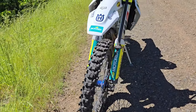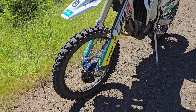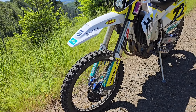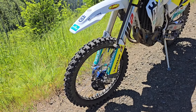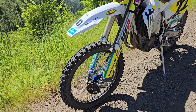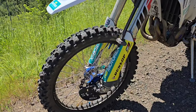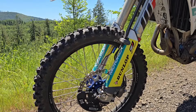I like a narrower tire because it bites better in the front and doesn't tend to climb up out of the grooves. There are a lot of single track muddy grooves up here where I ride and I want it to bite in turns. I could see if you were on sand or really rocky terrain the fatty would have its place, but I'm talking about for me and the kind of riding I do — the narrower front tire is what I prefer after trying the fatty a few times.